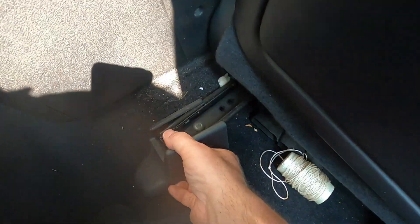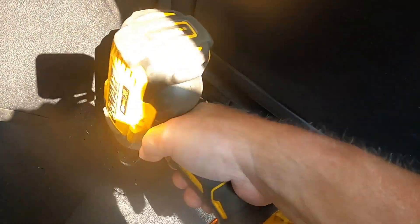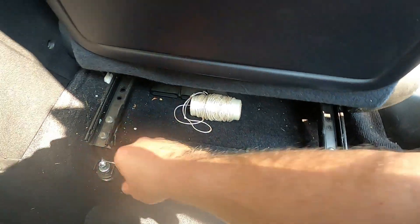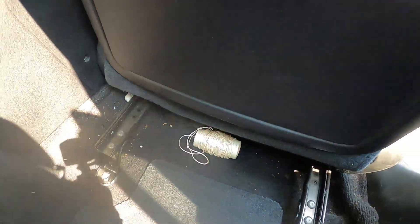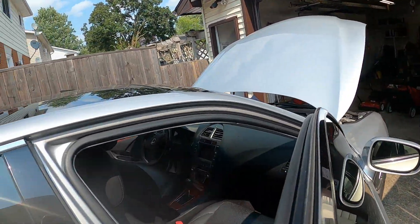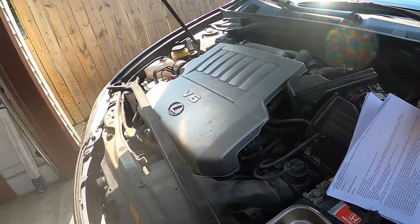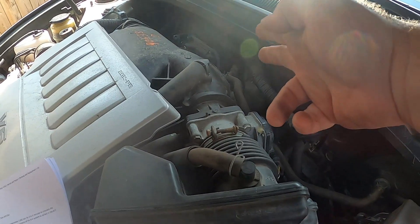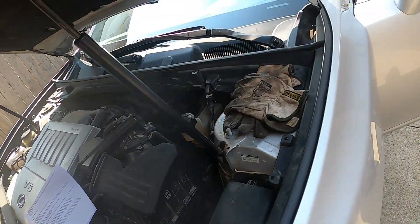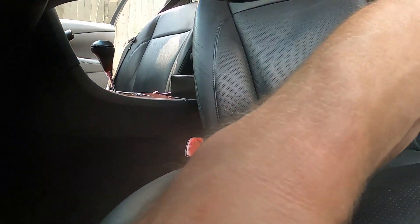You want to make sure you do that. You just come out here and you've got a couple of bolts to pull out. I'm going to pull the battery cable. I already got it loosened. I also already took out the strut support crossmember because I need to get down into the heater hoses and the evaporator core lines. The battery negative cable is loosened off, so let's get that disconnected. Now we're going to get these seats loosened up here.